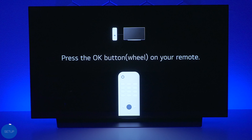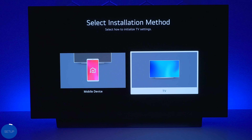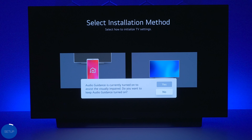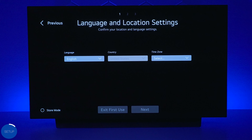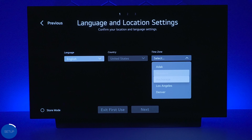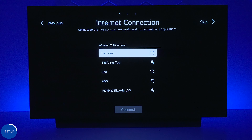For the next few minutes I'm going to walk you through how to initially set this TV up using the remote control, but you can also use the LG ThinQ application. The TV is plugged in and turned on. Press the center button on the remote — on this screen you get the option to use your mobile device or your TV remote. If you don't want audio guidance, press no. On the first screen choose your language — I'm choosing English. Since this is a US model it's grayed out. Then select your time zone — I'm going to choose Los Angeles. At the bottom there's an option for store mode — leave that alone, otherwise you'll get the same demo loops you see in stores.